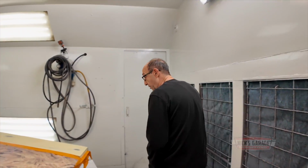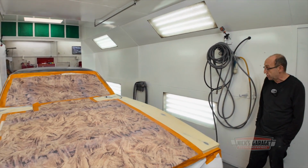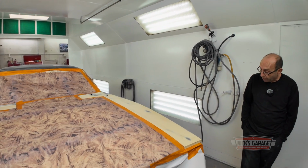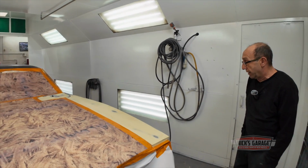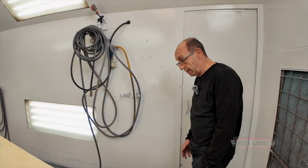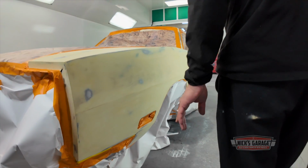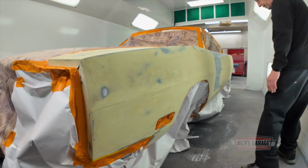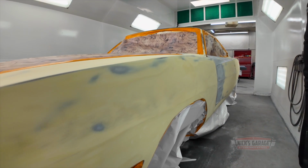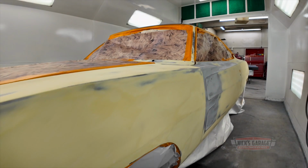And this is obviously the driver's side. It's the same story. The fender wasn't a prize package. All the lines have been sharpened. They will be dulled out again, but only once we put the polyurethane filler, we'll get a different view of the car. And even on this side, you can see how we've sharpened all the lines with the sandpaper so that we have nice, crisp, straight body lines. I believe that we're going to end up making a really, really beautiful car.